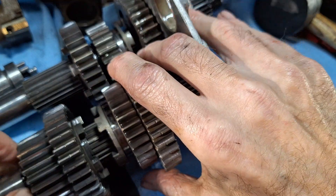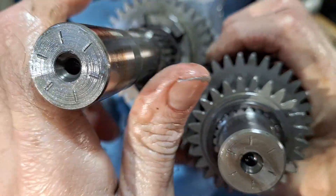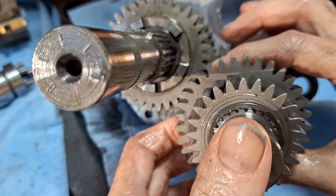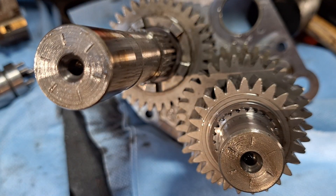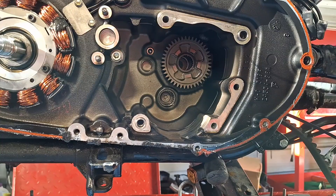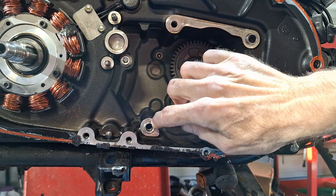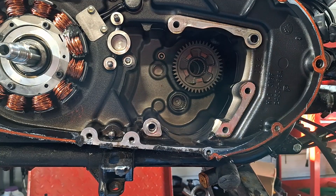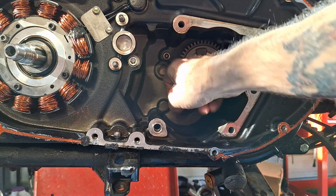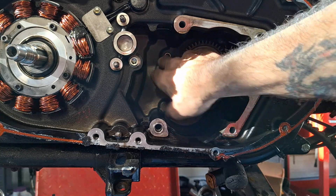So I'll pull this thing the rest of the way apart — probably not tonight, I'll probably do that tomorrow. At the very least, I need a shift fork for first and second gear. That's your inside there. Now on the '04 and later, same transmission setup pretty much, except you can't actually take it apart in the bike — you've got to pull the engine out and split the cases to get the transmission out. Other than that, it's identical. Your counter shaft bearing here, main shaft, and that's your shift drum goes in there. That's your main drive gear right there.